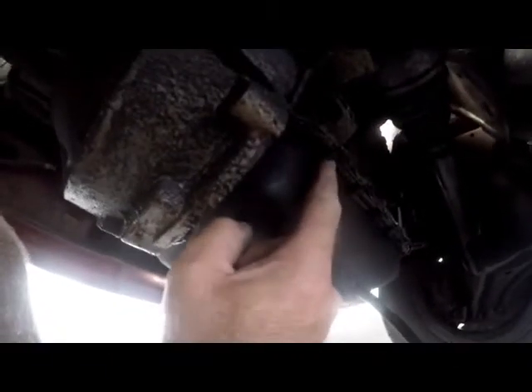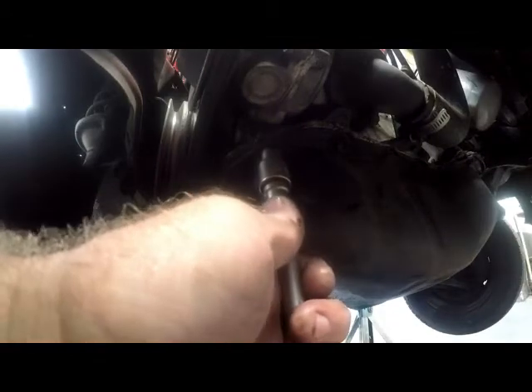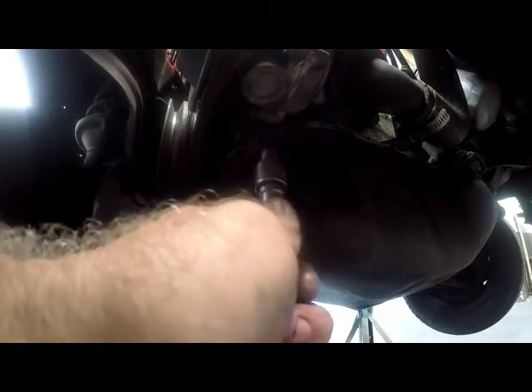So we're down here and you can see the sump there. Size 19 socket spanner that we're going to be using. The next step would be to loosen up these bolts here — there's about 20 to 22 of them with a size 10 head. Basically what I'm using here is a half-inch drive long extension, size 10 socket and a ratchet — all half-inch drive. Just loosen up all the bolts like that.